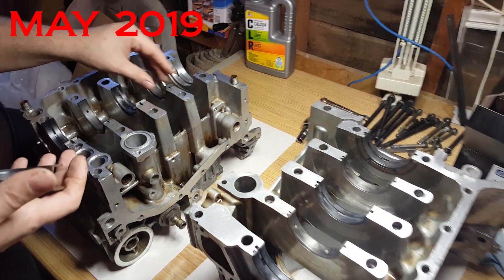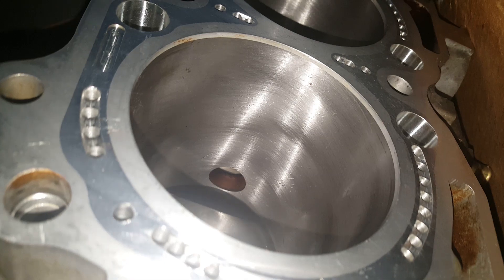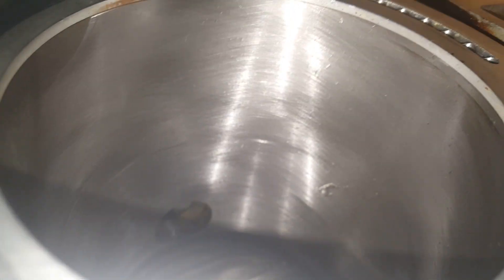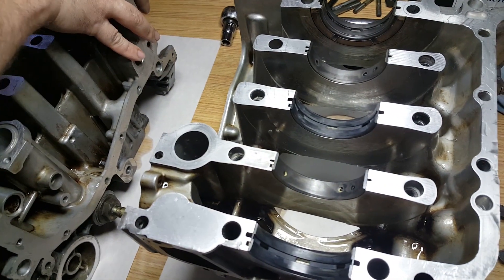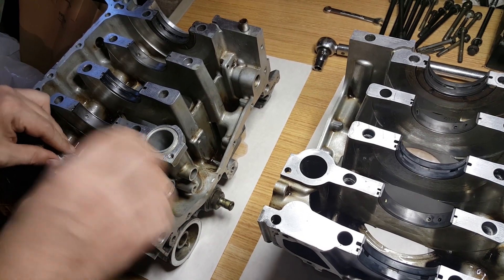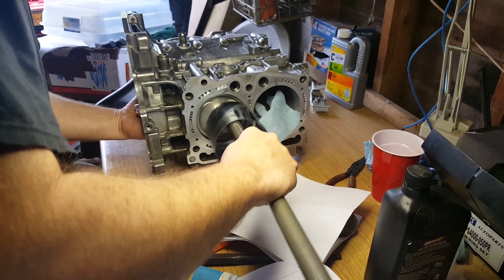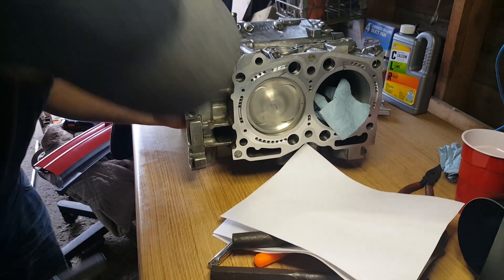So we're putting this together for the last time. We just got it back from the machine shop — they honed the cylinder walls — and now it's going together for the last time. We just got done cleaning it thoroughly. Now we're getting the bearings put in, and this is the last time the bearings are going in. They've been in quite a few times now. We've checked for clearances twice already. There are no rings on the table.